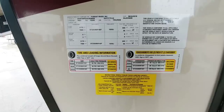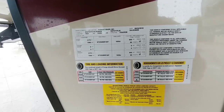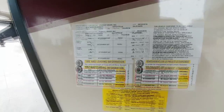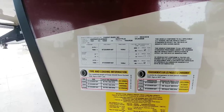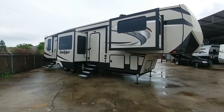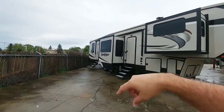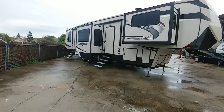Let's take a quick look at the numbers on this unit. This has a gross vehicle weight rating of 15,500 pounds, a cargo capacity of 3,377 pounds, utilizes 7,000 pound Dexter axles, and 235/85/16 F-rated tires. They have a good rating to the tire even though they're a cheaper tire, and you'd still probably want to swap them for new tires after 5,000 to 10,000 miles max. With a fifth wheel this size, you could probably tow it with a one-ton single rear-wheel truck if you have the correct tow rating; however, I would recommend a Dually for something this large. It's got an incredibly tall profile — it's almost a straight profile going back. This unit is relatively heavy, very long, and has a tall profile, so I'd definitely recommend a Dually pickup truck.